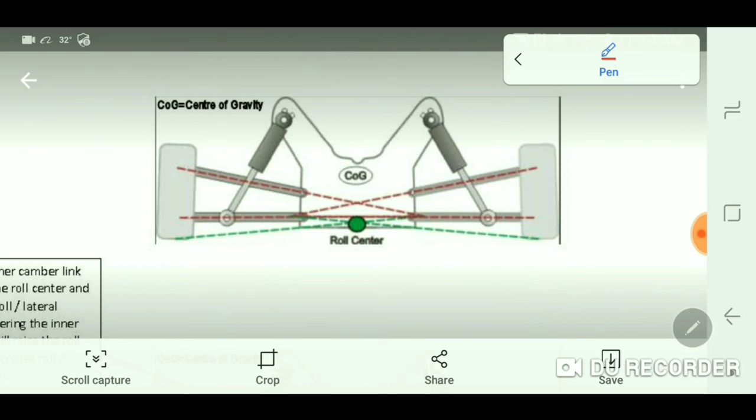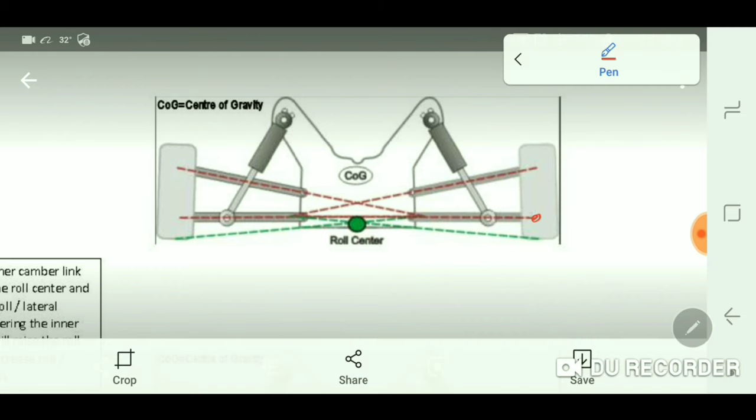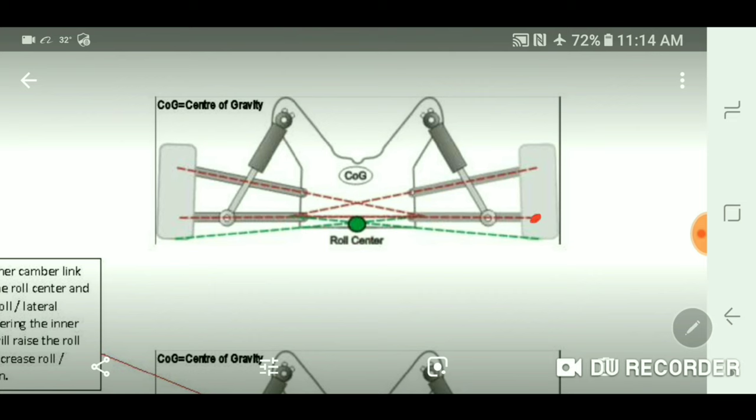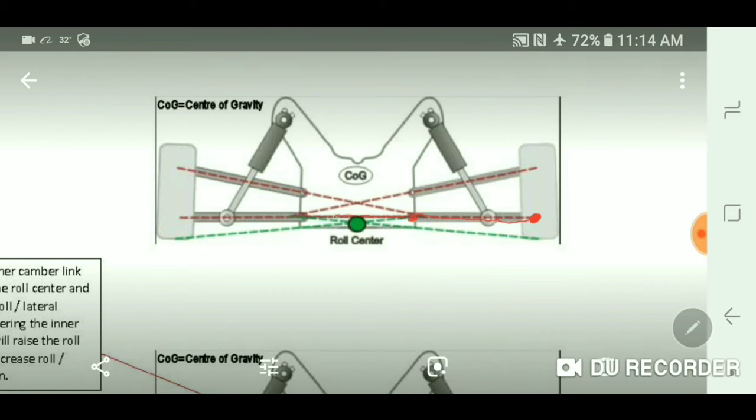Let's take a look at this photo. It's the rear shock tower with the rear lower suspension arms and the rear camber links attached to the shock tower. On the left and right inside of the tire we have the locations where the hub is attached to the lower arm and where the camber link is attached to the top of the hub. To draw out a roll center diagram, starting at the right side of the vehicle, you draw a line from where the rear hub attaches to the suspension arm straight through where the suspension arm is attached to the hinge pin on the car.